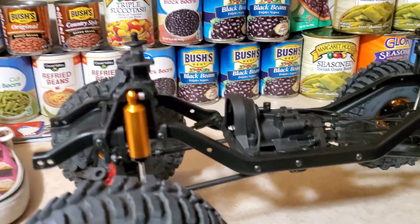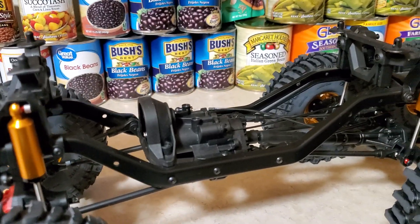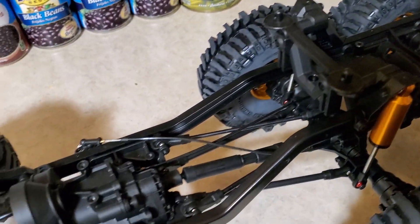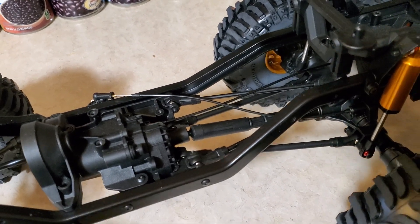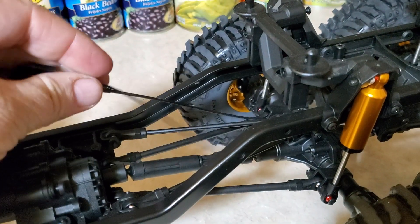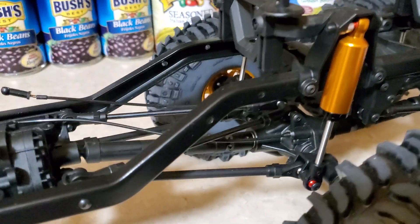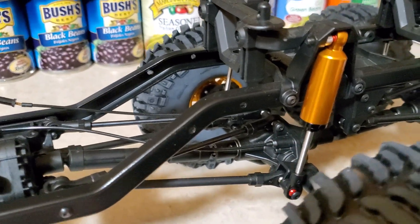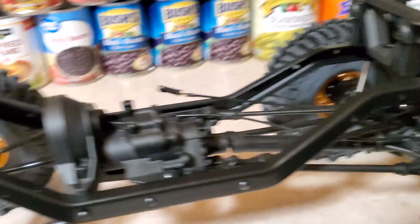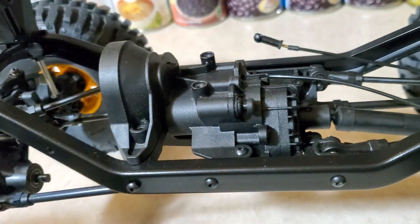I've had this sitting around for about six months. I haven't finished it because I haul crude oil and I've been really, really busy. The rear axles are two-speed right now and I have the lockers in them. I'm going to take the lockers out and put the spool in the rear ends so it'll be solid lock like a sport — so it's going to be a sport six-by-six. I'm not sure on the body yet. I've got a sport transmission in there.